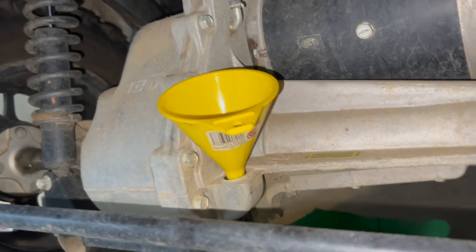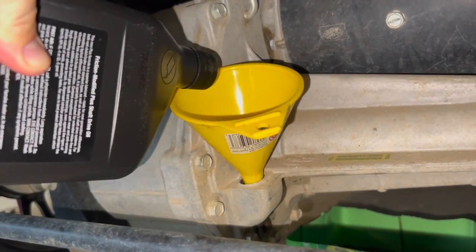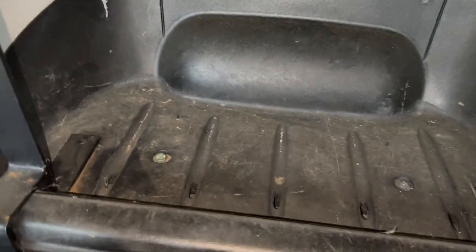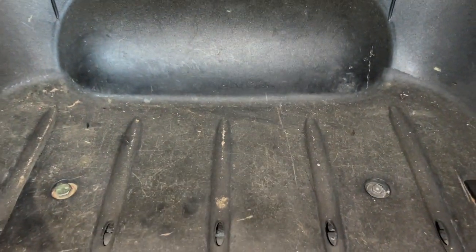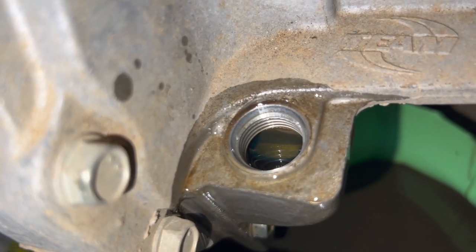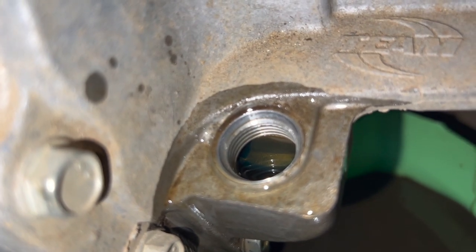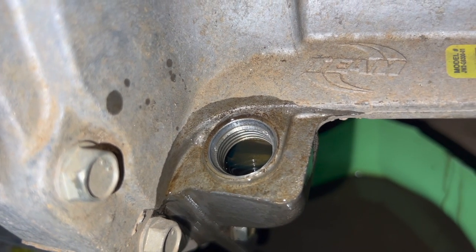Since my cart's lifted, I can use a small funnel and still have room to get the quart to pour in there if I'm pouring from the high side. If your cart's not lifted, you'll need to remove this pan in order to be able to get a funnel down and fill the oil from above. You should fill the oil to the bottom threads for the oil fill plug. It'll take approximately one and a half quarts, and I did have to jack up the back end of the golf cart to get it all in there.